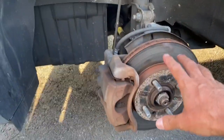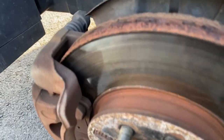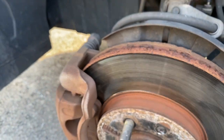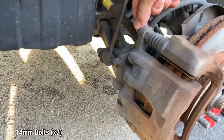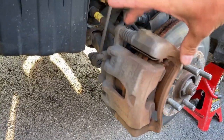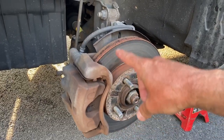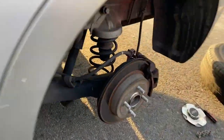This is our front brake assembly. These are our brake pads right there — if we look down in there you can see they're getting pretty low, definitely time to replace them. We have a 14 millimeter socket needed here and another 14 millimeter here that will remove the caliper from the caliper bracket so we can get to those brake pads. We will also need a c-clamp to compress the piston on the caliper back to fit it over the rotor.